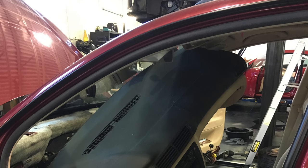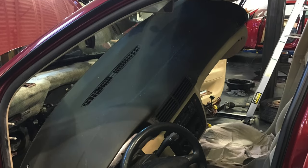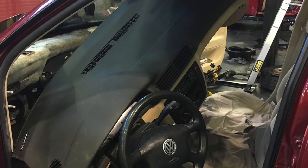Now, the big question, is this a DIY? Well, this is generally not the easiest part out there to replace. Some of the newer vehicles like the Passat that I mentioned that will trip a check engine light, they're actually quite a bit easier. You can get to it without taking the dashboard out, but this one came out of a B5.5 Passat. That one you're pulling the dash. You're basically taking everything from the driver to the firewall out of the vehicle, or at least away from all of that in order to get the heater core out.